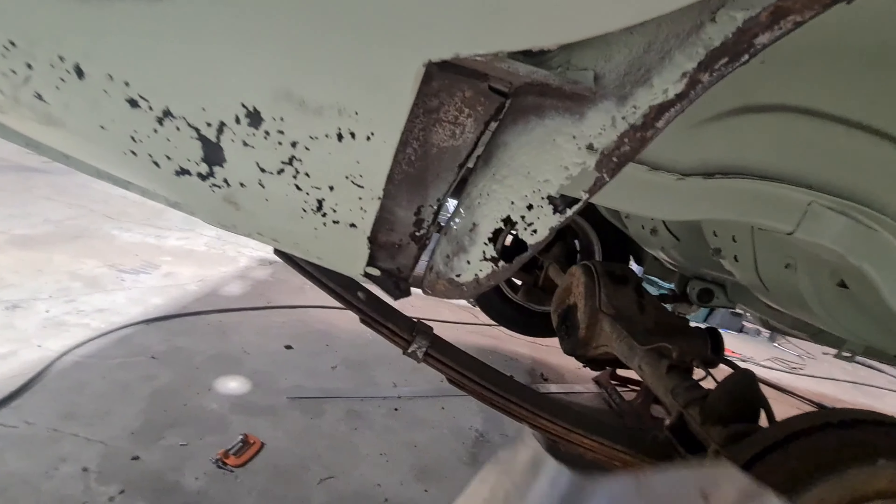I'm going to get the quarter cleco'd on — I need two hands for that. That's the outer lower quarter on there, fitting really good, happy with that. The lips are meeting up nice, clamping up good everywhere. The only little piece to go on is this small piece I had to cut out just to get the lower quarter joint, which is spotted there. And I've got this piece for the center of the arch because it's all rotted and taken away there. This is why we unpick things — because this creates rusty water that gets trapped under everything else, and that's a nightmare in there. If it ever gets wet again it'll just trap more rusty water, which will track down and rot the lower out again.